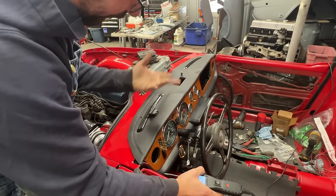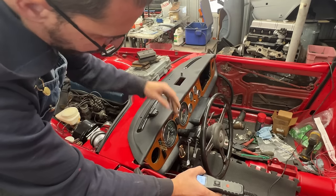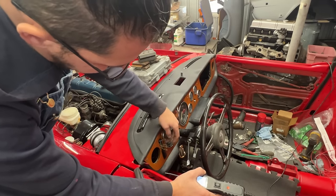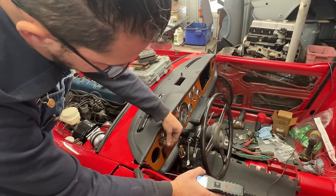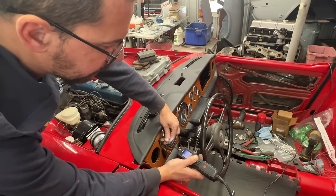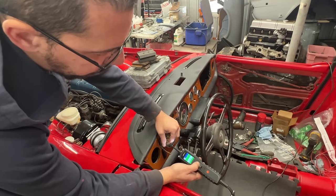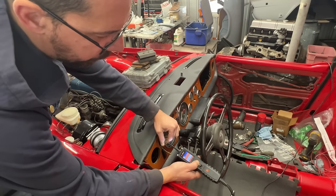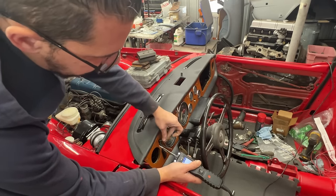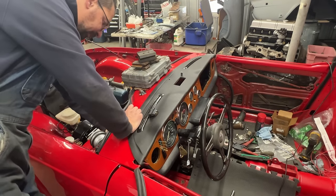What should happen is the switch connects power to either the blue or the red wire — blue with green and red with green — and we have a brown with green. When I put power to the blue or the red, the motor should work, but it doesn't. I have a voltage drop — I'm at 4.8 volts here, so something is consuming my power. And to be honest, I can feel the wire getting hot, so something is definitely going on there.